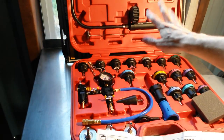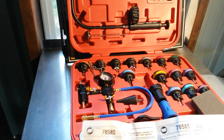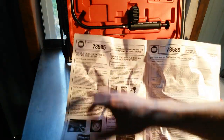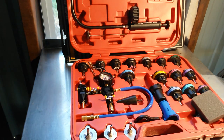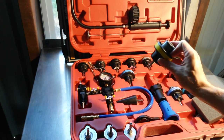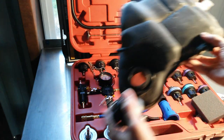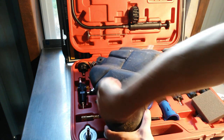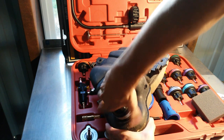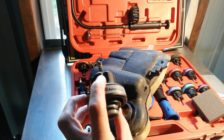This is a complete kit. It does both cap and pressure testing as well as vacuum fill and vacuum leak testing. The first page goes over the various functions — four different functions. The second page has the various models and what the different caps go to. As far as I'm concerned, I'm just going to grab a cap and make sure I know which one fits. Like for Ford, it's the gray one — goes right on the degas bottle on most Fords. Once you know what color goes for your vehicle, you're going to remember by color pretty much.